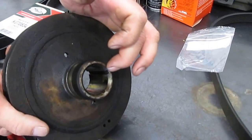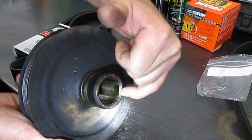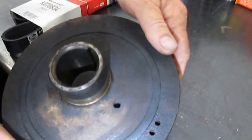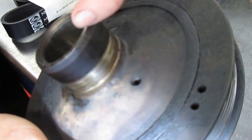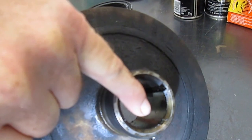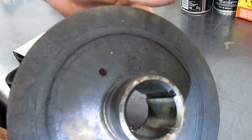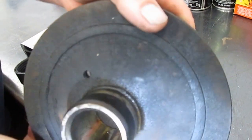What I found when I removed it — there's a keyway on the crankshaft where it's supposed to go on. You can see this groove in here — someone put this on before and cracked the balancer all the way down the side. They just forced it on, smashing the keyway down and making its own groove, that's why it cracked. So we found a good used one to replace it with.